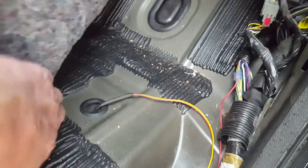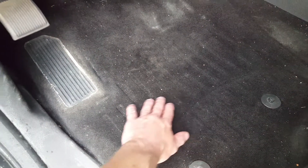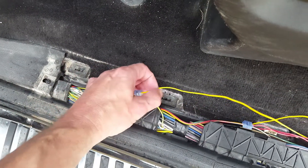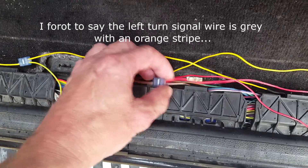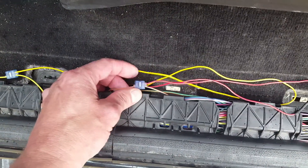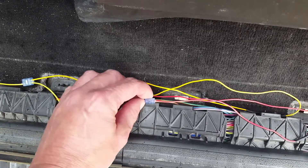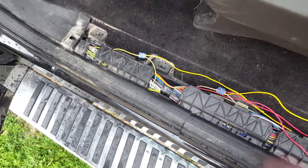While I had this apart I also wanted to show how the wire runs underneath — you just pull the carpet back, you can see the grommet, make a little slit with a utility knife, and run your wire up and down into the cable tray. Over on the driver's side that grommet is in about the same location. I routed the wires inside behind the kick panel and down into the wire tray. Here's the yellow and green wire connected to the yellow wire from the Big Rig Ice — running lights — and there's my fix for the left side turn signal. These connectors are UB2 Scotch-Lock jelly-fill connectors I got from a friend who works in the telephone industry.